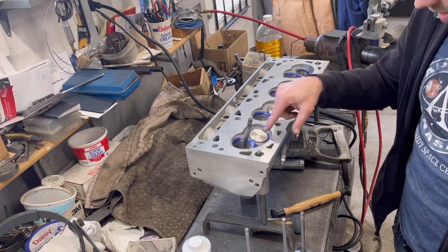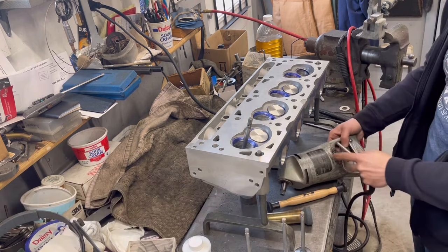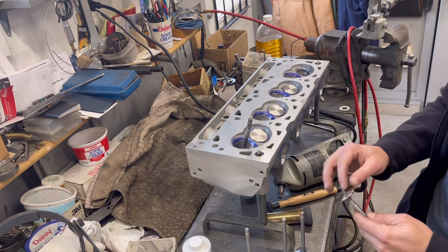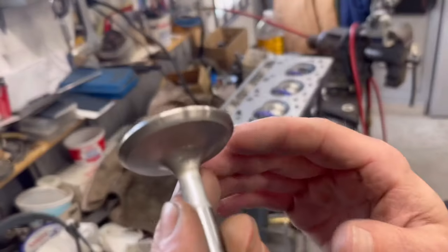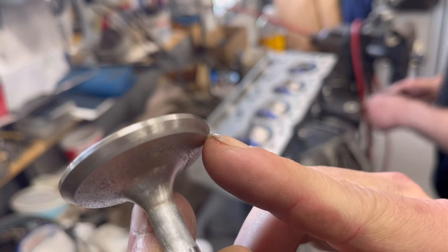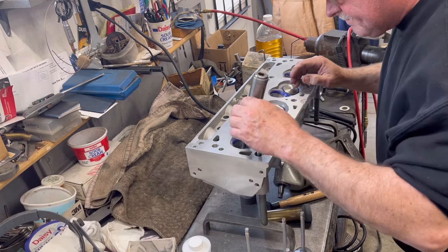So what we did was apply the Dykem blue. Jimmy went ahead and took his old grinder with the stone kit at the right angle, sharpened the stones up, and started touching up the seats. We did notice some nicks. When we decided to lap these valves in — we already ground the exhaust valves and those were okay — the valve is at the correct seat angle, but the witness mark when we lap the valve is really low down. It actually needs to be higher, so we're going to need to regrind these valves. For now, we'll get the intake side done.